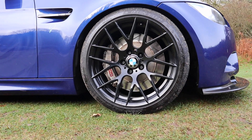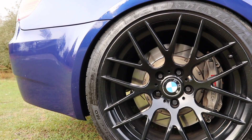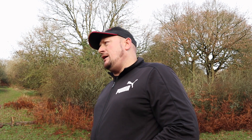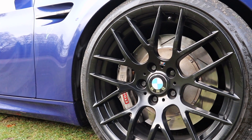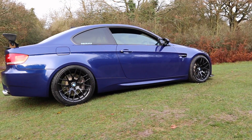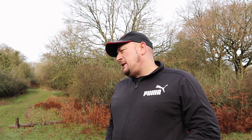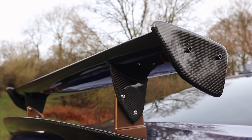Brakes are StopTech Trophies — slightly lighter than the standard StopTechs. Six pots at the front, and you've actually gone the whole way around with rear ones too. The pads are RS29s — anyone who knows those pads, they're pretty much a track pad, an endurance pad. They're quite squeaky, but the stopping power is just phenomenal. Obviously fresh fluid every time you go out. Suspension is KW DDC — this car never had the EDC, so KW do a kit called the DDC which you can fine-tune a little bit more than the standard one, and it's adjustable. Running Millway top plates, about two degrees of camber. The rear spoiler is a GTS — that looks mean. That wing comes stock on the GTS model.